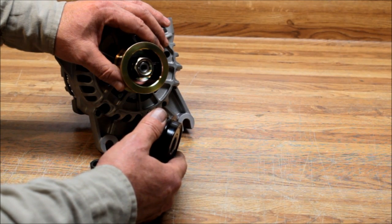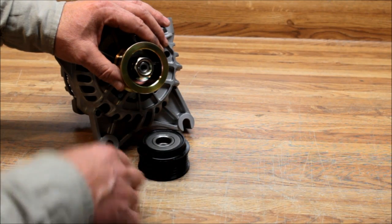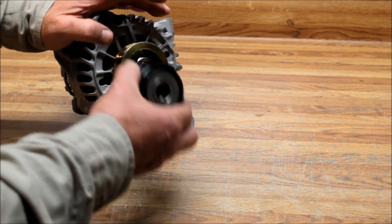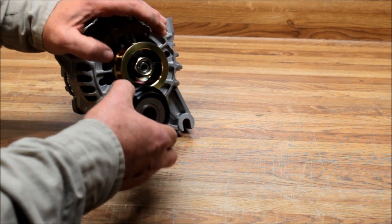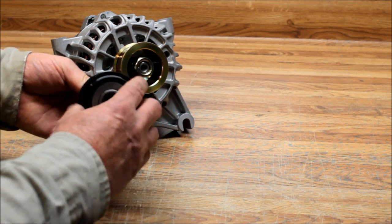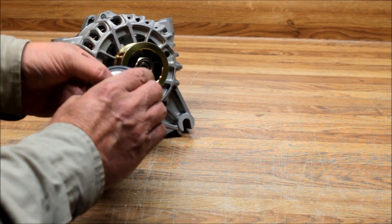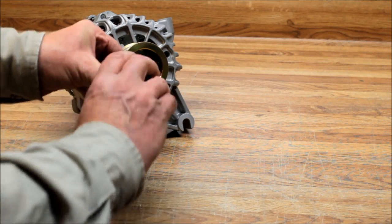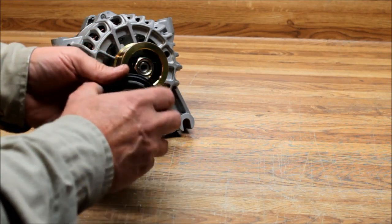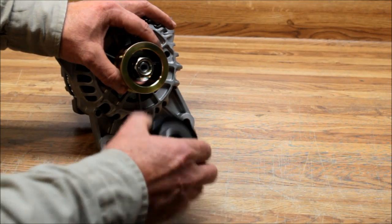They have all kinds of claims for what these clutch pulleys are for. I had a call from a guy today who was told that the clutch pulleys are set up so that if your alternator freezes up, you won't lose a belt. But the problem is that can't be true — if your alternator was freezing up, the pulley would still try to drive into that frozen alternator. The clutch pulley freewheels in the reverse direction, but going the other way it wouldn't matter — it would still try to drive into it and blow your belt off.